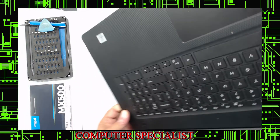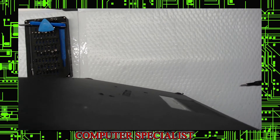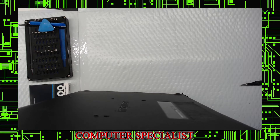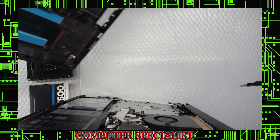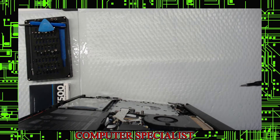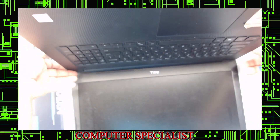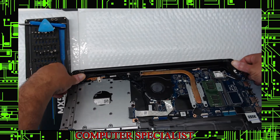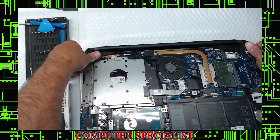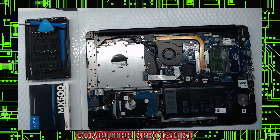Once it comes off, put it to the side — a little bit of advice, don't put it on the ground where you can step on it. Once you get it here, put your fingers down by the hinges and slowly shut the lid. The hinge reinforcement on all these new Dells and HPs is horrific, so shut it down slowly. And here is the drive.